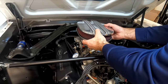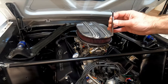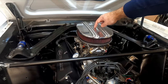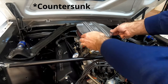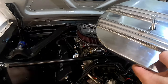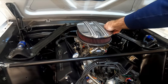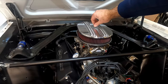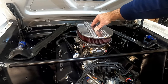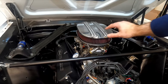Putting this back on — that sits good. I did want to point out that this air cleaner comes with an allen head stud because it has a chamfered edge on the top, which makes a nice clean install. However, I'm in here often enough taking things apart and tweaking things that I don't want to chase an allen key. I prefer just a typical spin-style wing nut on top for quick access — pull that off without needing an extra tool.